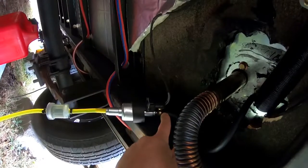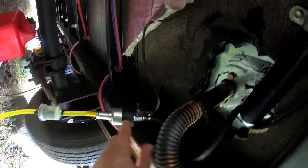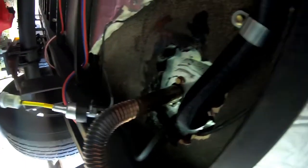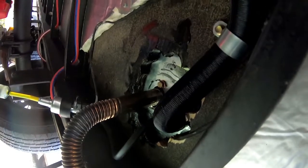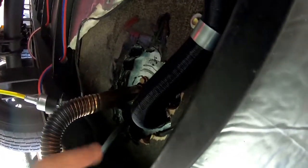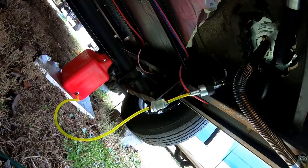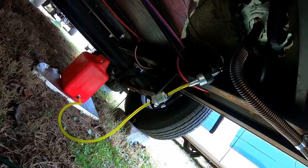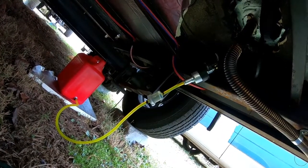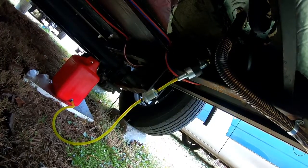The line going from the heater pump down to the fuel pump, with the sound-deadening rubber mount, runs cleanly alongside the fuel pump wire, which slips through a dedicated area in the mounting plate. We've observed this under high load with a lot of heat and the fuel line does not heat up whatsoever — it's been really solid. On the lowest setting we use about a quarter gallon of diesel fuel per day and can maintain about 77 to 79 degrees inside the cargo trailer.